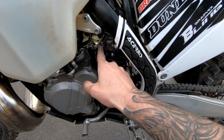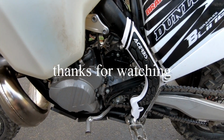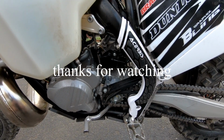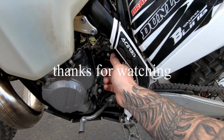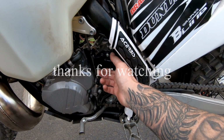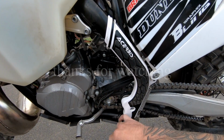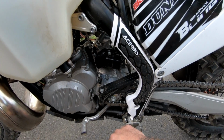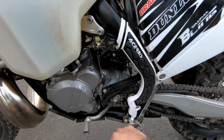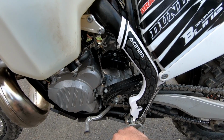So I got mine all the way in, and there's a slight hanging idle, but I believe there was anyways when it was just stock. I'm not sure. Some people talked about getting their throttle position sensor reflashed or something, or recalibrated, I'm sorry. I don't know, but I'm gonna try this out and see how it works, see how it starts in gear at the race this weekend, and hopefully no more stalls going down hills.